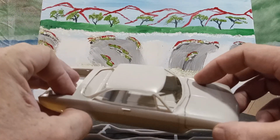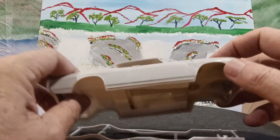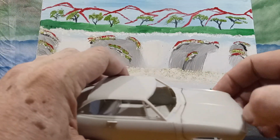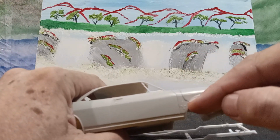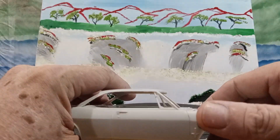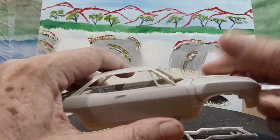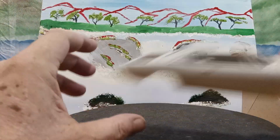This is where I'm cutting the foot off, right across here. My brother and I, back in the 80s, used to run a custom shop up in Indiana, where we would take the stock front end, weld the hood down, and cut the fenders like this. I'd put trunk latches on either side in this angled place, where when you close the front end down, click, click, and it would lock down solid. Had a couple of T-handles under the dash. You pull, pop it loose, and then flip it up. People love that stuff.